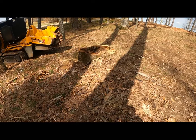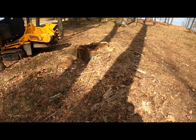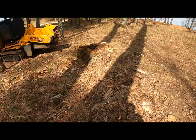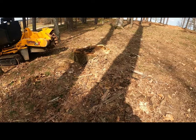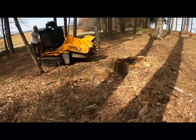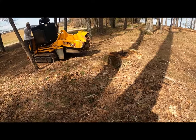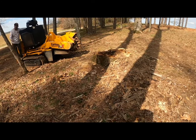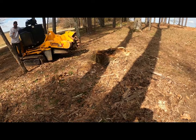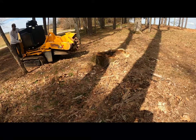I think I was one relay off, but it's such a tight harness, it's hard to tell which one of the 25 wires it might be. Right. Do you think that's a common issue with them, or is that just... It's just like a spade connector. Yeah. And I think the spade is just opened up enough that it's not making good contact. I got you.